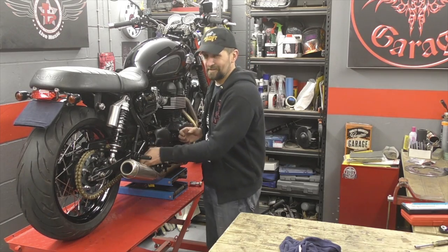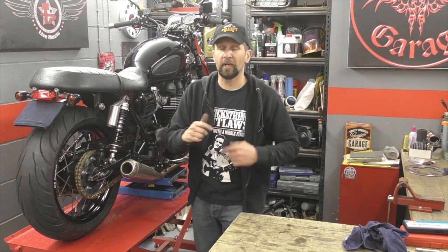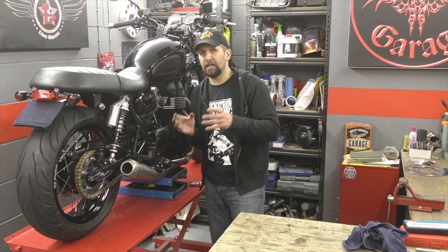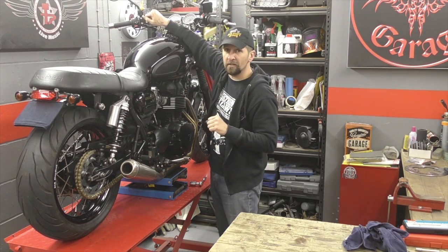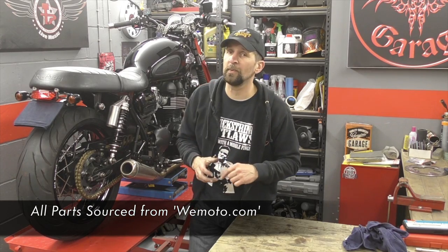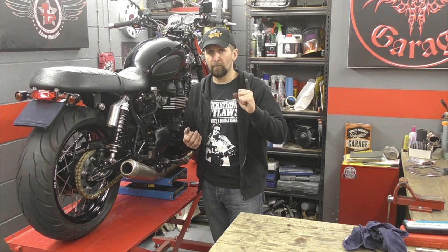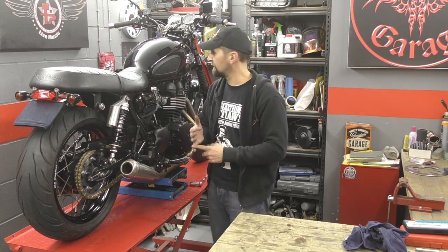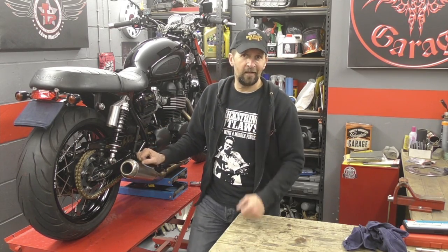Next job is the front — we're going to do the front disc, the same caliper procedure, and also a clutch cable at the same time. I want to make the bike more user-friendly for Penny — she's got little hands and little wrists, and I want the clutch nice and smooth. I found from Wemoto they do Slinky Glide cables — a stainless cable that's coated so it can't corrode, lasts longer, and gives an easier clutch pull. That's what we need. I hope this has been useful — three more videos to go. Thanks for watching, ride safe, see you next one.